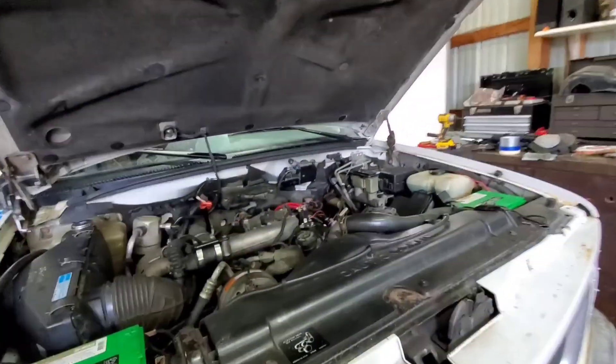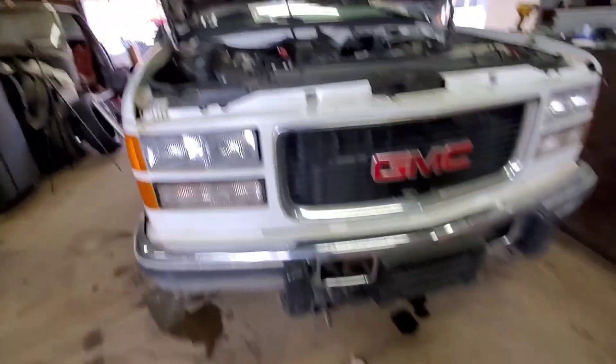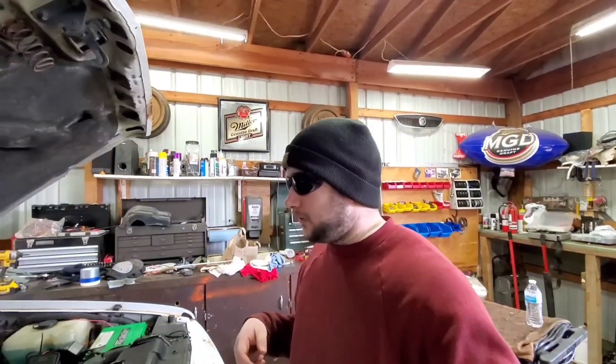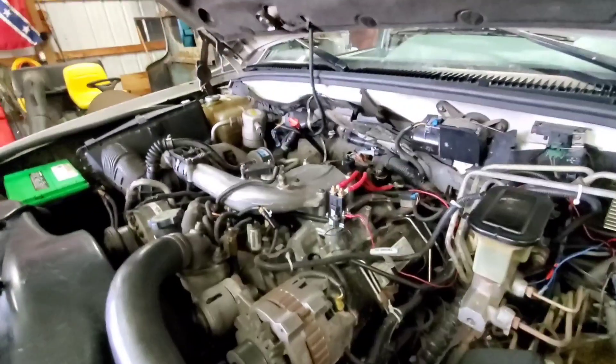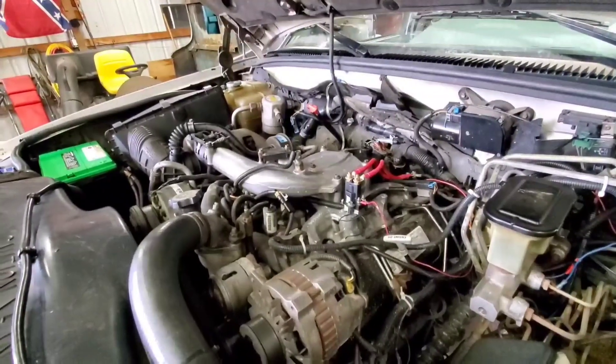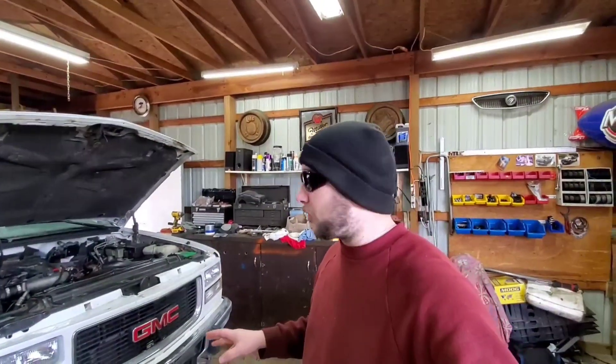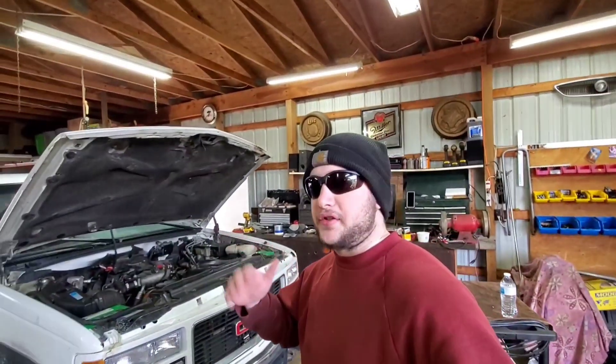I really wish the dually was an old Detroit. Here we got a '95 6.5 - this is actually the truck that my plow came off of, this is Luke's dad's truck. We got to do an injection pump on this thing, and I have an injection pump - 94-95 VIN code F trucks run a 5068 part number injection pump. This is a DS4. The truck is currently trying to run away - if you let it sit at idle it gets to a certain engine temp and it's just erratic, all over the place.